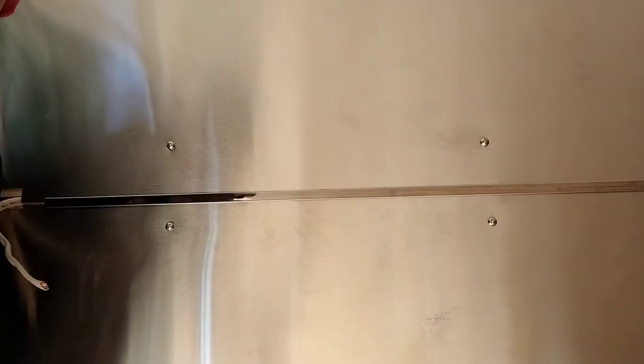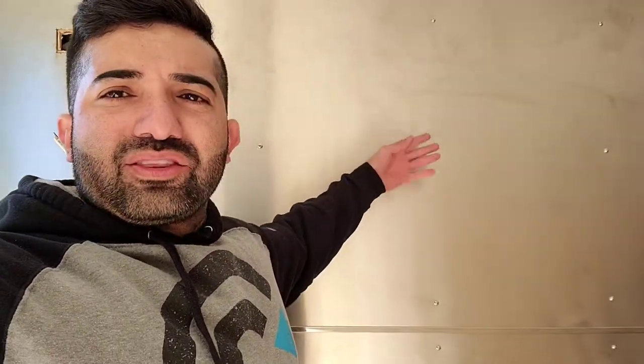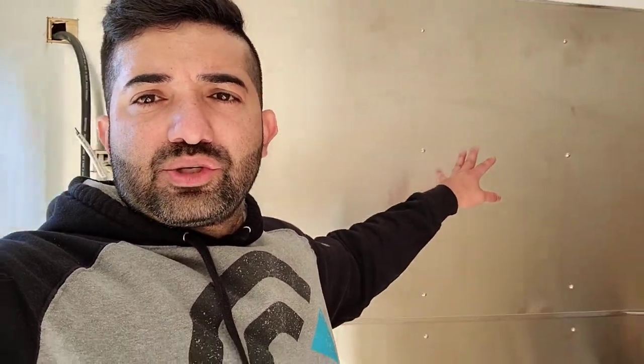You put it on this nice little transition piece that I wish I still had on my food truck, being rolling burritos. This is Frank Baltiers with the DIY series, how to build a food truck. And we're on the walls now, installing the 304 stainless steel. It's a 20 gauge used for restaurants, commercial applications. It's nice, it's cleanable, it's wipeable, and it's easy to take care of. So that's why I like this little piece of stainless steel.